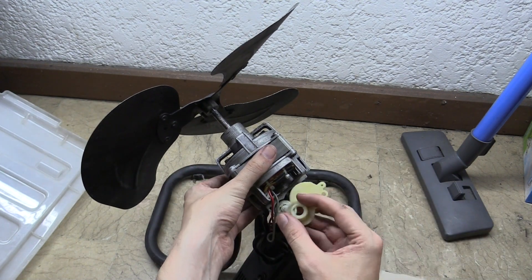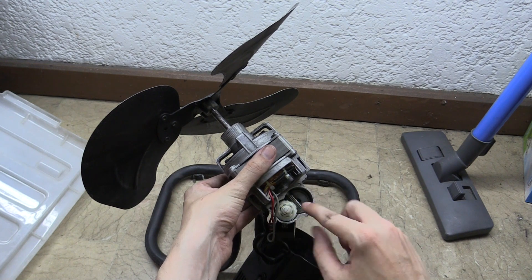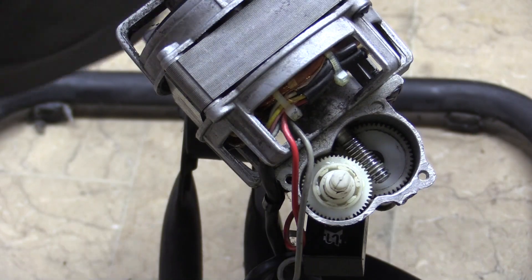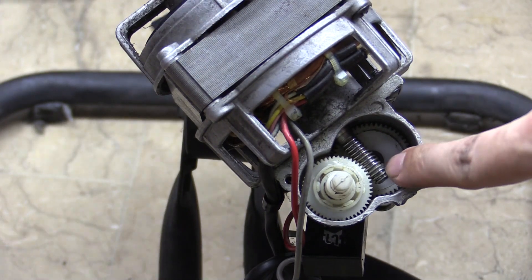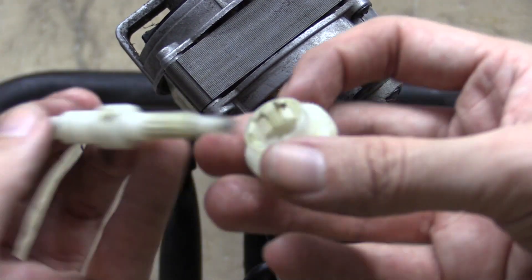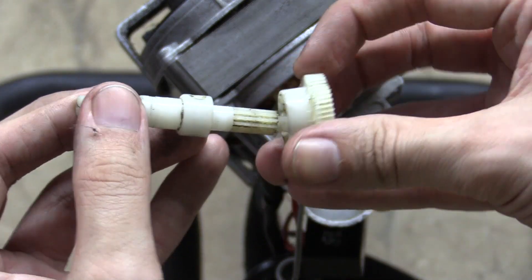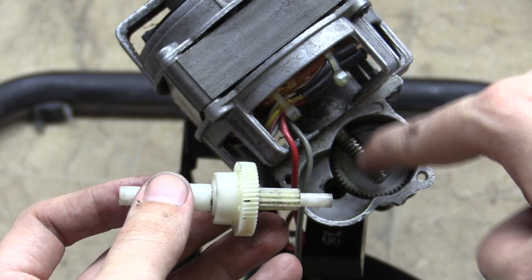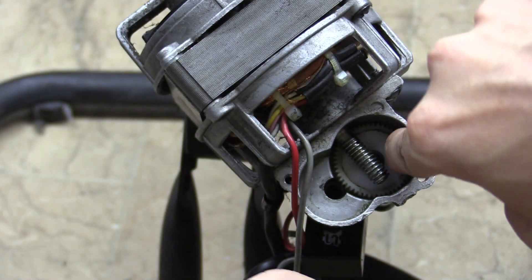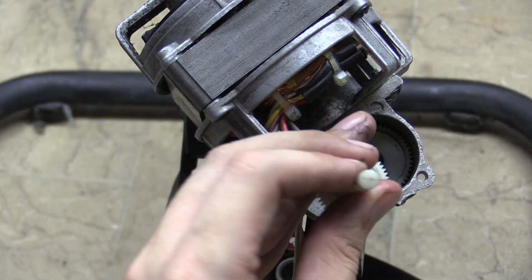This does have a cover and it's normally greased up, but I've removed a lot of the grease. So let me zoom in on that gearbox. If I spin the blade at the front, you can see how this worm gear is turning, and in turn it's turning these gears, or these cogs. You can see the various different components — the worm gear goes against this one, which then turns this one, and then ultimately turns this one here.